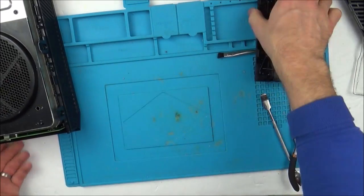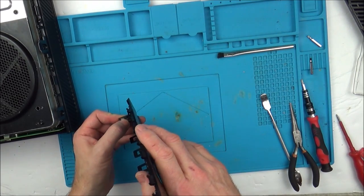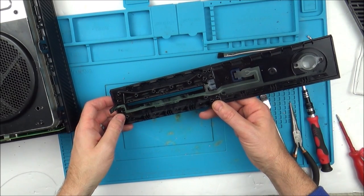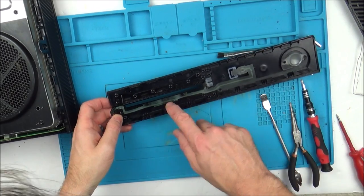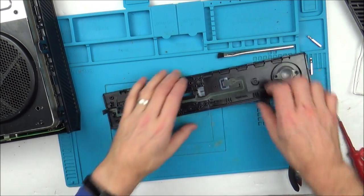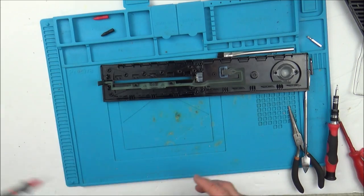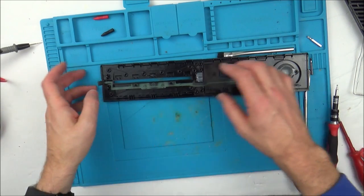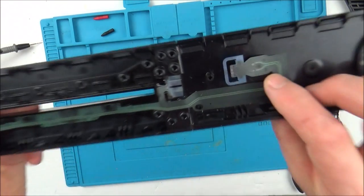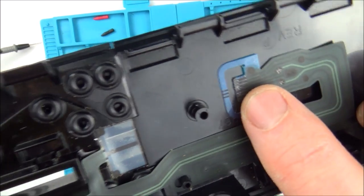I just want to have a look at this sync button now before I go much further. So to me, it looks like it is pressing. I'm just going to trace the contacts and see where they go to. So they go on those two there. I wonder if I press it with my multimeter, pick up those little carbon tracks there. Got somebody to press the button for me while I measured here and I couldn't feel it. Not 100% sure it is going to recognise it because these carbon tracks look a bit iffy, but saying that, look, I'm pretty sure it does end up in copper there.